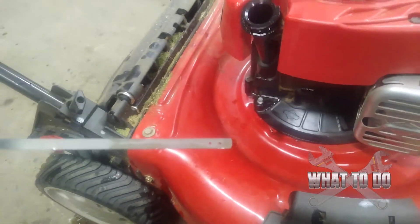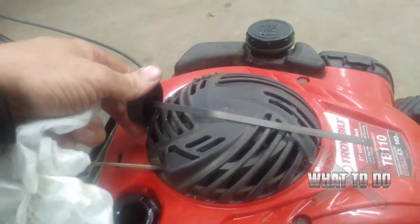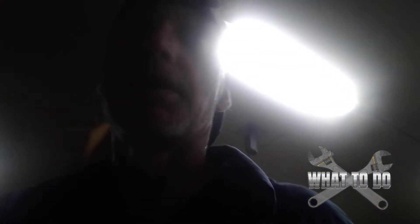When you're pouring oil in, oil gets coated all around this spout. If you put this in real sloppy, all that oil is going to hit the sides of your dipstick and you won't get an accurate reading — it'll be caked up from rubbing on the side. Try to go as straight in as possible without rubbing the sides, and make sure you click it all the way in. Don't just go down until it touches because you're still missing about a quarter inch. Pull it straight back up and check. We're right at the bottom, so we'll add more.